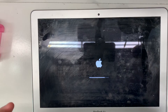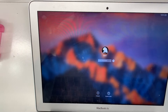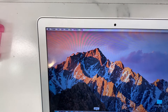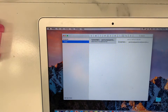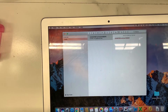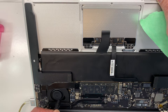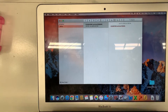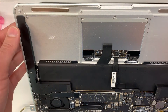Let's see if it detects the trackpad and if the keyboard is working. Yeah, it's working properly. The speed is down. Let me bring the microphone close to the fan so you can hear — you don't hear anything anymore. So that's all it was. If you have an issue like that with this type of MacBook, the first thing you want to check is the trackpad cable. If that doesn't work, then there's another issue with either the keyboard or the IO board.